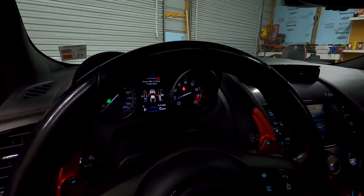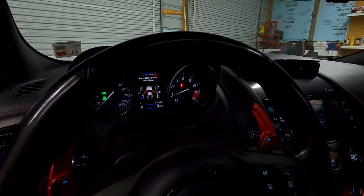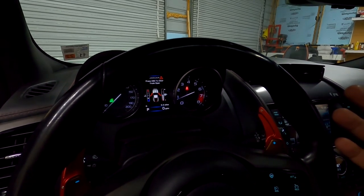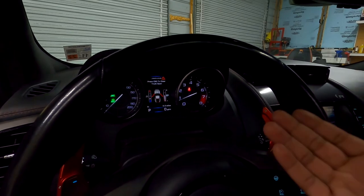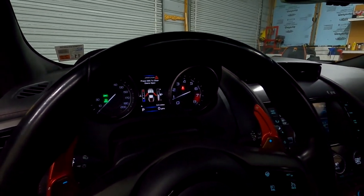And when that power broke, the whole steering wheel was black. Now it looks like everything's fine. If any wires were shorted, we'll get an immediate code because it'll come back on right now. Those two wires on both ends of that ribbon were supposed to be together. Technically not shorted, they're actually the same circuit. But you had two powers, two positives, two negatives. Somebody could probably confirm that by looking at the manual and seeing the wire pin out. But right now, no issues.